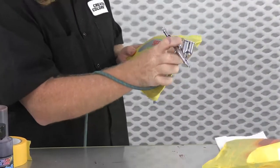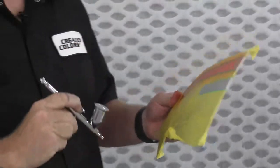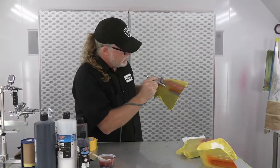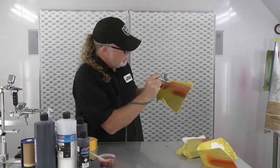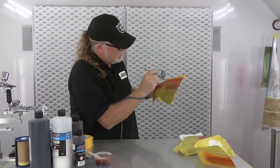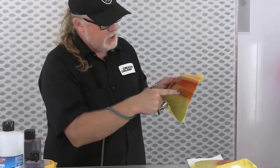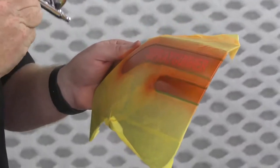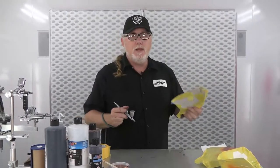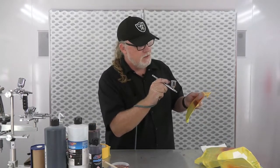Let's do the exact same thing on this one. Always make sure everything is pressed down — sometimes it will lift a little bit. A little bit of humidity in here is not bad — no humidity is bad, too much humidity is bad. It's a Goldilocks thing — you want to be right in the middle. I know the top of the Spray Gunner logo is darker than the rest, so I hit the whole thing, dried it, and added a little bit more candy on top. I had a little bit of a spit from something else in this airbrush earlier — I'm going to come in with some black candy in there anyway so it works out. There's an old running joke: a good painter fixes a mistake and the client never knows; a great painter makes a mistake and charges more.